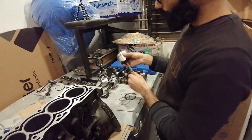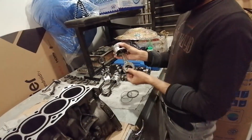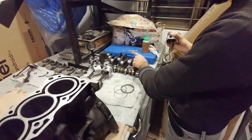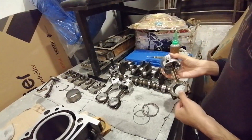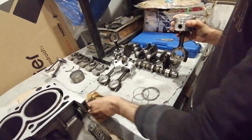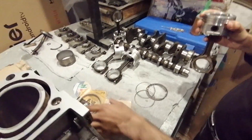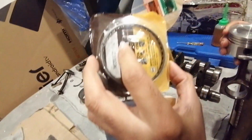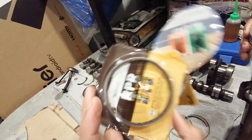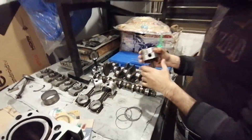The pistons are purchased along with the connecting rod. We have used new bearings. This is the oversize cut. Now the rings — look, the size is written here: 1.00. These are 1.00 oversize rings, okay? The size 1.00 is visible on the ring. These are standard oversize rings.